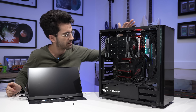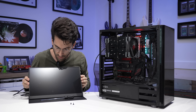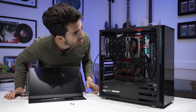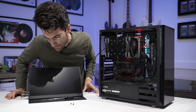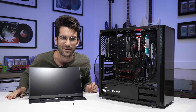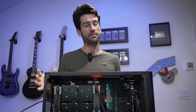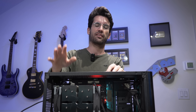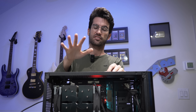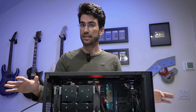It powers right back up with our HDMI cable connected to the motherboard for integrated graphics. But initial impressions — we're in the same spot as before. I think this motherboard's coming out. We've cleared the CMOS, tested the power supply, and removed the graphics card with no change of state to the symptom. The CPU debug LED is still illuminated — the system is on right now — and nothing has changed, which tells me that all of those other things we've tested are not the cause.